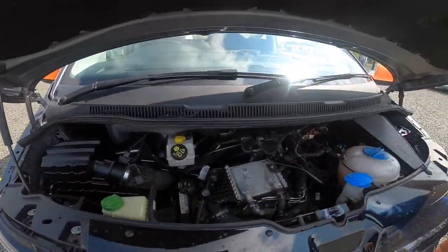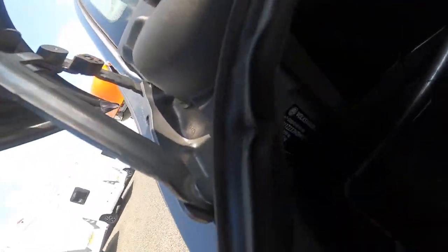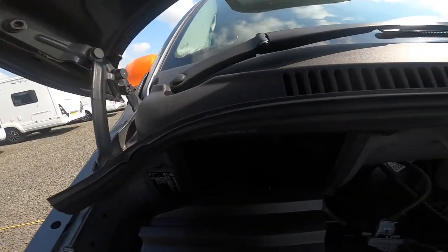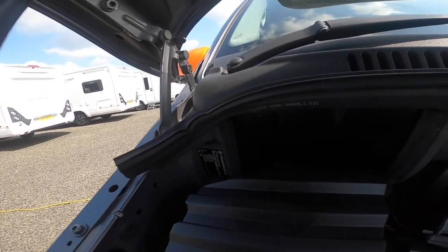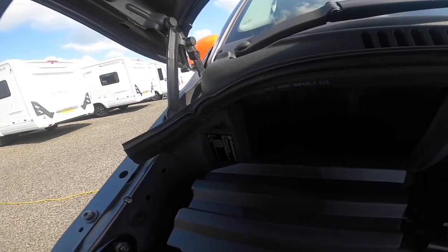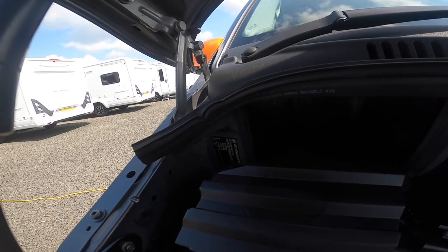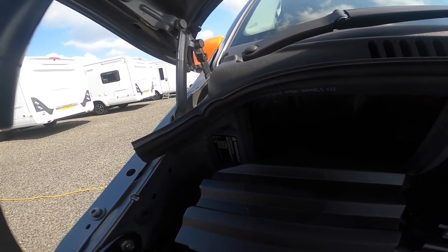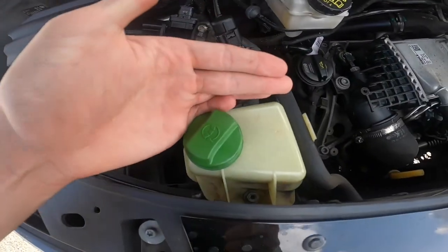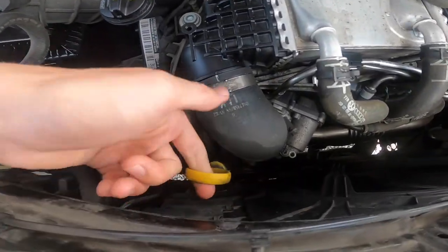You've got gas struts on it so no need for a stay — just pop it up. The gross vehicle weight is two thousand eight hundred kilograms. If you were planning to tow, you can tow up to a train weight, but the VW Transporter and whatever you're towing can't exceed 4.9 tonnes. You've got your front and back axle weights and your chassis number on there, along with your power steering fluid, brake fluid, oil filler and dipstick for checking your levels.